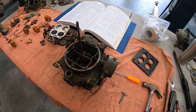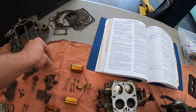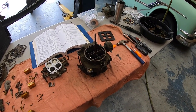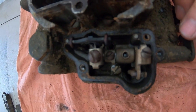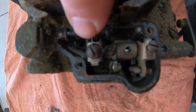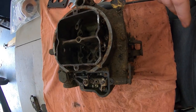We have the other carburetor off the four-door car and it's not the same model number — it's a 2108S whereas the one that came on that car is a 985S. I'm going to tear that one apart and see if I can get to the part I need. These are the pieces I was having an issue with, and you can see these move freely. You have your accelerator pump here, and these are your needle jets — that moves freely too. I need to get the top plate off this carburetor, get the parts I need, and I'll be done with this one.